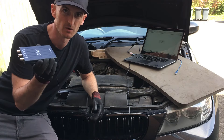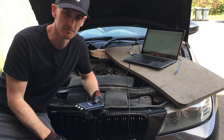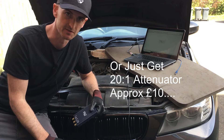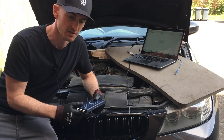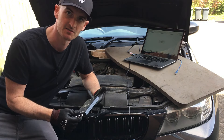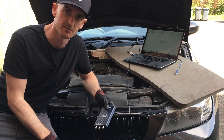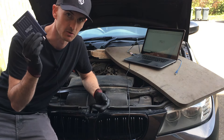All in all it's really quite a good scope for the money. If you want to measure things like injectors you might have to go for the automotive version of the oscilloscope and pay that bit more money, but for measuring everything else — CAN signals, PWM, frequency modulation, sensors, and longer term signals measured over seconds rather than milliseconds or nanoseconds — it's really quite good.